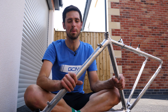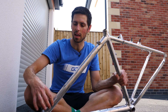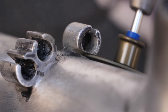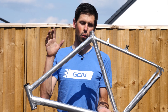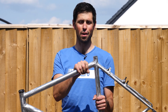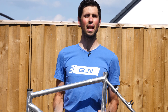I'm just sat down having a little rest. It's been fairly hard work getting all of the paint off this frame back to a bare aluminum finish. It's nearly there, ready to start the final sanding and polishing. I've got these lugs on the frame for the cable guides — I don't need those, so I'm quite simply going to cut them off and smooth the finish back down so the frame looks nice and slick. We've now got no paint left on the frame. The guides for the cables, I've ground those off and just need to sand those back to get them nice and smooth. Basically, I'm going to be doing more of the same thing over and over again, so it would probably make sense to queue a nice little montage with some music going. Hopefully by the end, we'll have a perfectly polished aluminum frame.